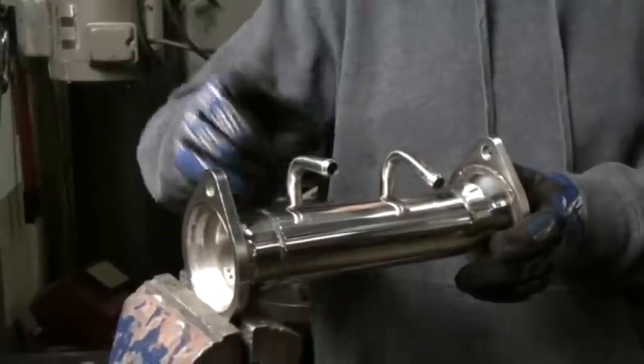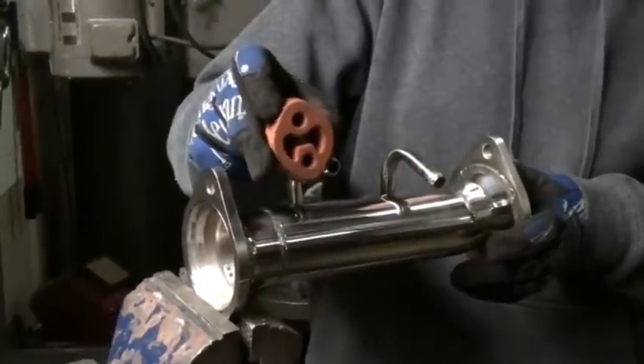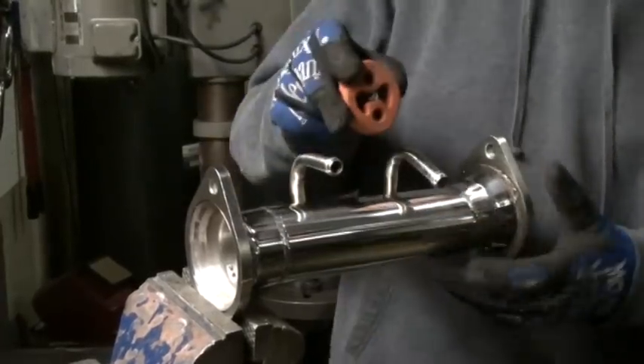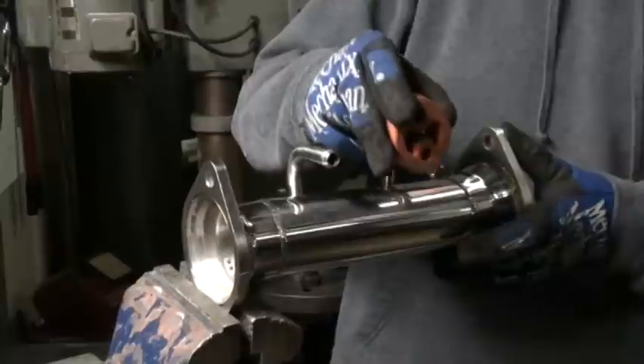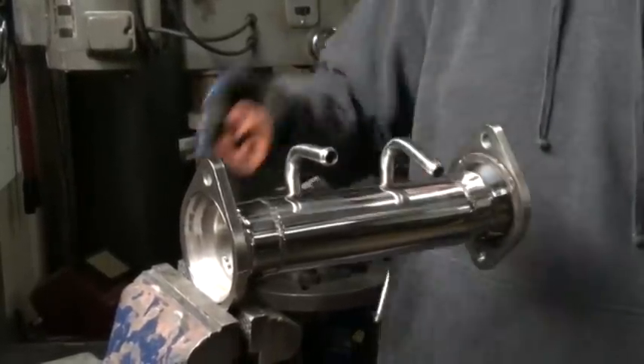The way I would do that would be to take the hanger and move it downward relative to my bushing, because that's actually going to make me push that up further to hook it on the bushing. Then I want this one to come upward, which will allow me to hang the exhaust lower relative to the fixed location of the bushing.